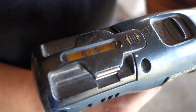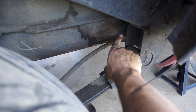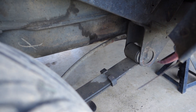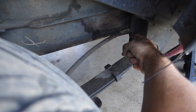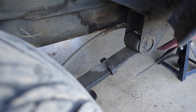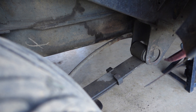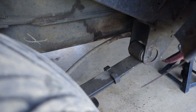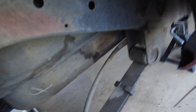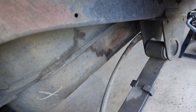This is kind of important. See this on top? Ronnie's drill has a level. That is important because on this side especially, the gas tank is right in the way over here. Like we need to drill through right here. Gas tank's on the other side. We can't drill back through this way. So we have to drill through this side and straight through to the other side. So the level makes sure that both of our holes are opposite each other. If your drill doesn't have a level, get a drill with a level. But make sure when you're drilling like this, you put a piece of wood on the back side so when you drill through, you don't drill into the gas tank. That's important.